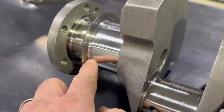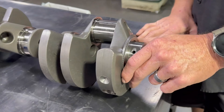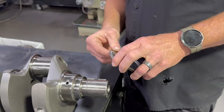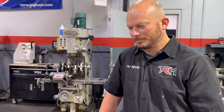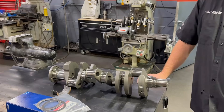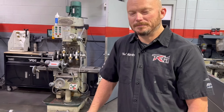Typically what we've done in the past is weld the crank up — TIG weld it, put some surface on here, machine it back down — and that's what you would ideally do. But this roller bearing system basically takes the place of that, so all the pressure is on the front roller bearing and it's not going to eat up the actual crankshaft. Back in the day when thrust bearings started becoming a problem, it was turbo cars. You don't really have thrust problems in nitrous cars or blower cars because they come up on the converter so fast. But converter technology has advanced — these things are locking up tight, with more pressure inside the converter.